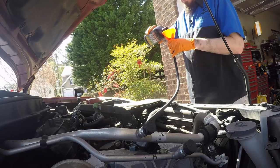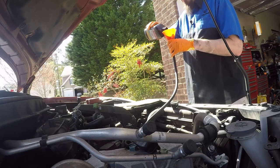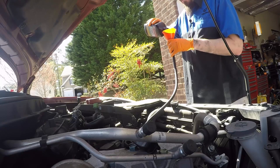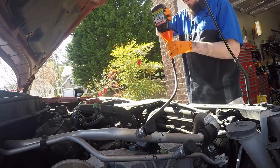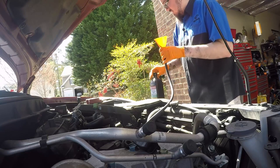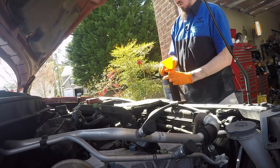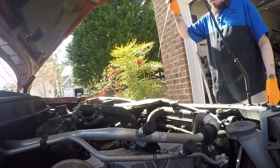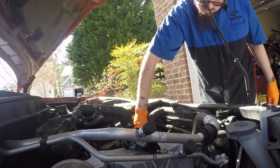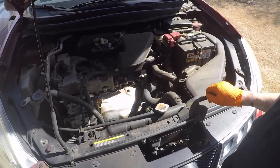It goes really slowly through that little tube, but thanks to video editing on YouTube this will look like it took no time at all. We're looking at about an hour and a half to do all of this — and that's with me pausing to look up torque specs and taking my time. You don't want to rush this work — that's how stuff gets screwed up, and I don't want to do that to anybody's car. Once it gets warm I'll pull the dipstick back out while it's running to check the fluid level. As long as it all pans out, we should be good. As always, thank you guys for watching — we'll see you next time, good day.